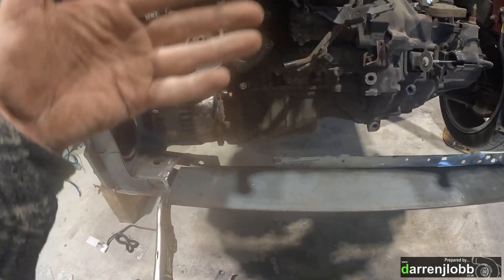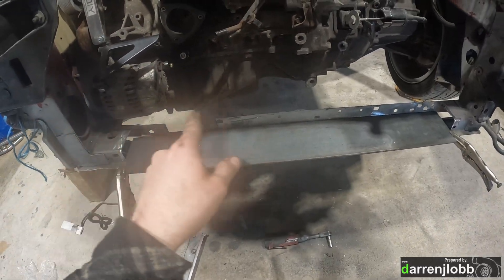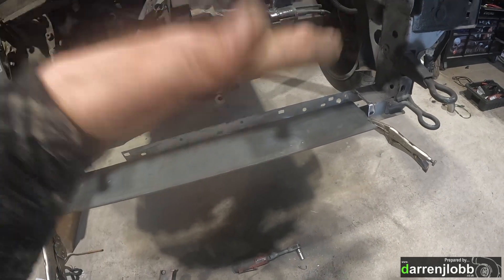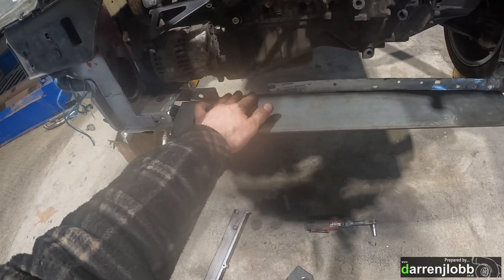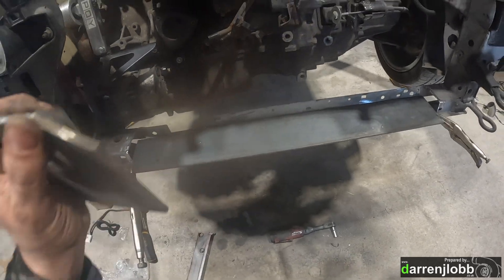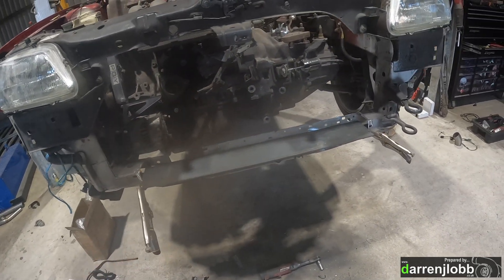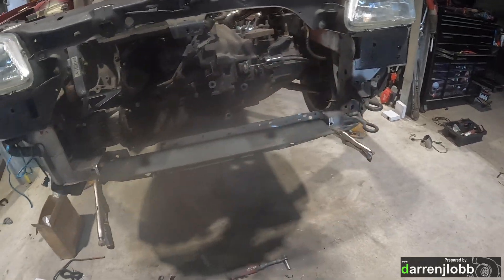So I'm going to have to bring the radiator forward back to where it kind of belongs. The only way to do that and get it down is I've sectioned out the original cross member here - I've just got a piece of steel clamped in at the moment. I'm hoping that's going to give me enough drop to get the radiator cap on without touching the bonnet. If so, we can plate all this in, section out here for the lower radiator hose and the temperature sensor, make it strong again, and put the two mounting holes in the relative position. I'll still try and get the radiator as far back as possible to give us as much room as possible in front of it for the intercooler and oil cooler. The incidental advantage of this Honda radiator is it's quite a bit narrower than the Peugeot one, so it's going to give us loads of room around the outside.